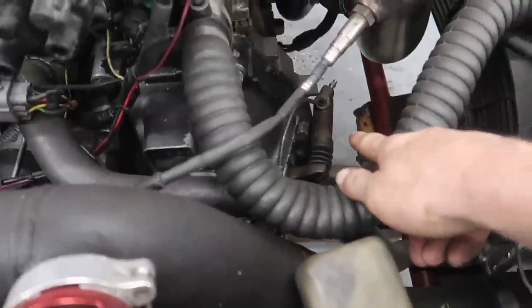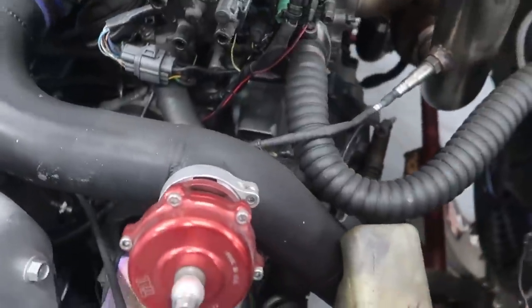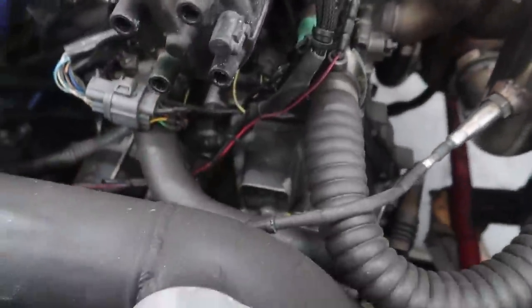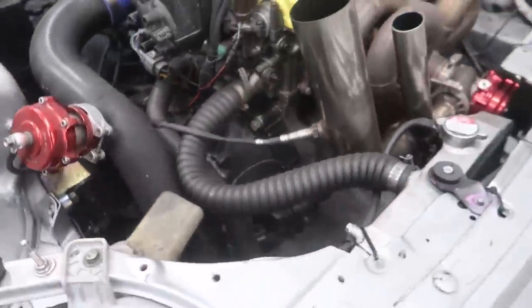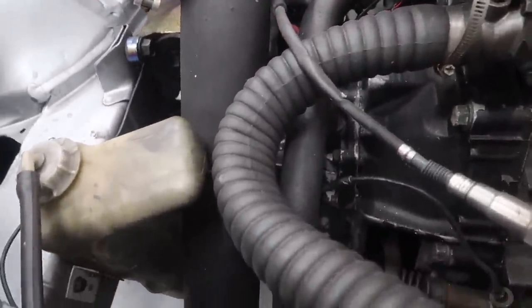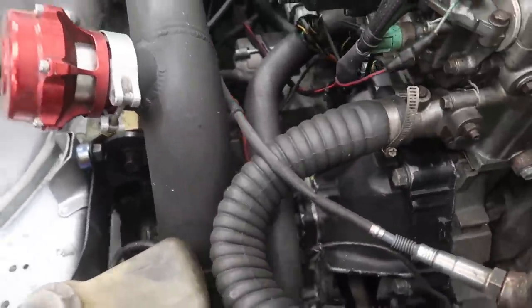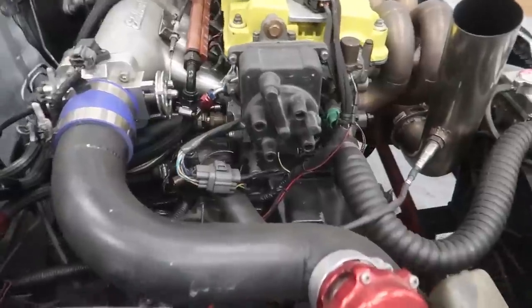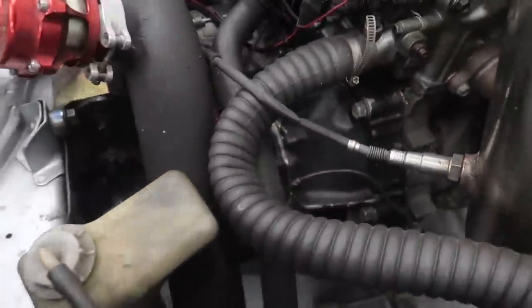To let freedom ring, all I need to do is pull this slave cylinder, these bell housing bolts, drop this — don't forget the axles and the wheels — then pull the transmission out. And then we're going to split the case halves and see what's wrong inside this transmission. I guess I'm about to tackle this thing and get it done. I'll have her out pretty quick, then take it apart and find out what's going on inside it.